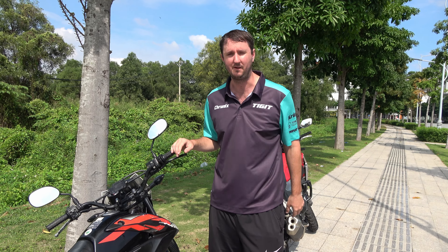So this should be a daily check or at least every two days, and then you're not going to have a catastrophic failure. That's good for us and good for you. So let's get started. You've got two different kinds. Some bikes like the CB have an oil window — a glass window to check. Super easy to do, and on a bike like a Honda XR or a Honda Blade you will have the old school dipstick.